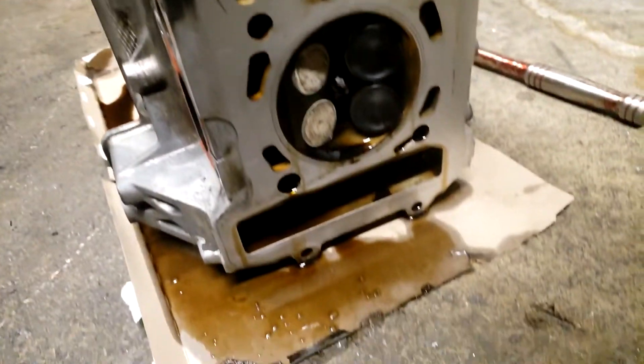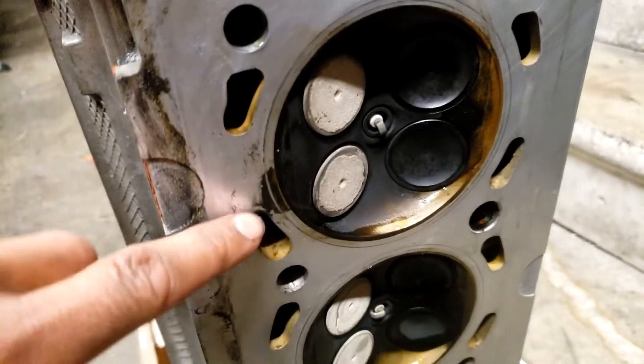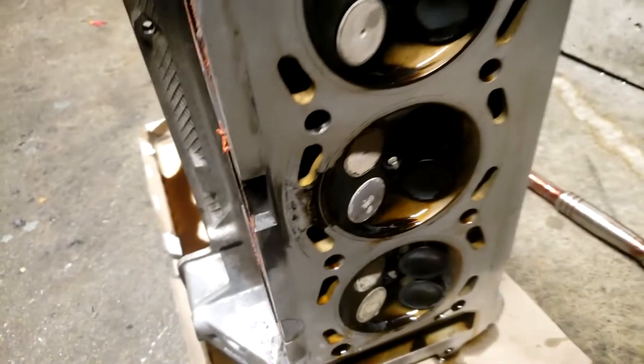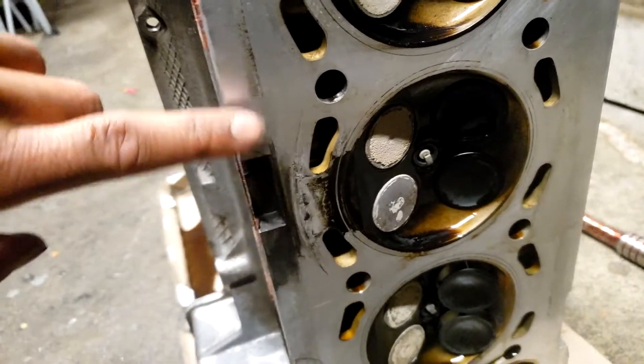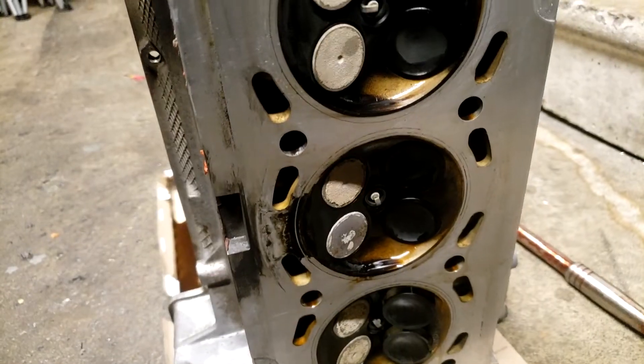This is the cylinder head. Cylinder 2, cylinder 4 — four looks pretty bad, it's going into the coolant. But cylinder 2 — oh my god, it made it all the way outside the deck and damn near torched the cylinder head.